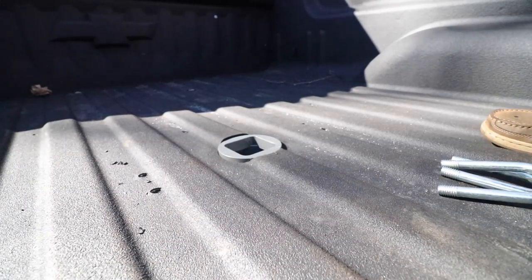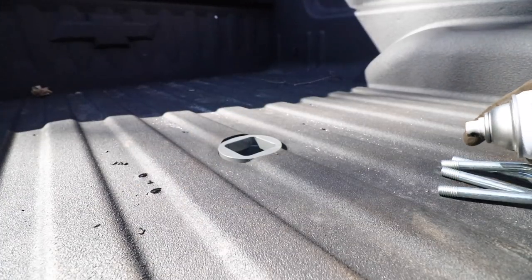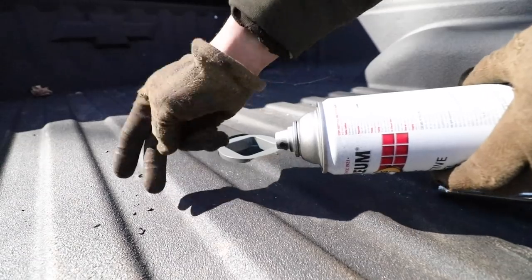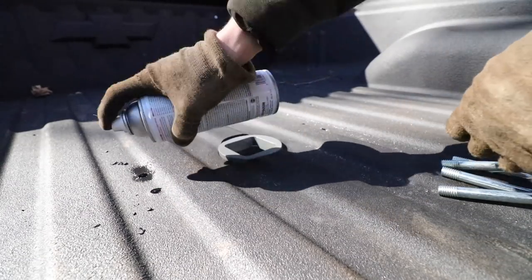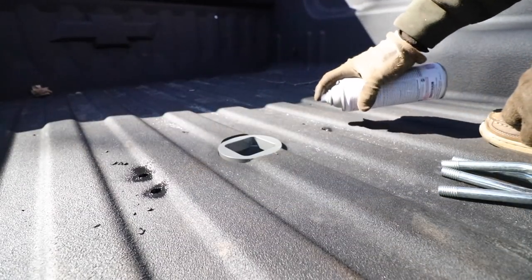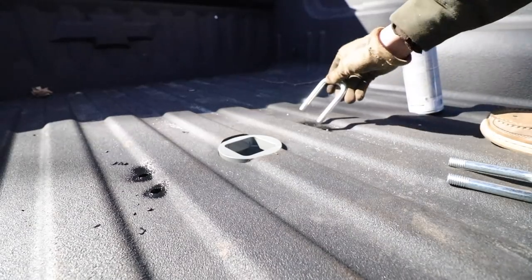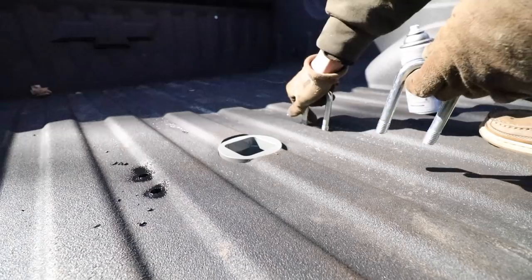Well, I'm very pleased to say everything's looking excellent so far. Now, this step is optional. I did it earlier when I installed the main ball hole here, but because we just bored fresh holes into our bed, there's going to be some bare metal, so it's up to you. If you want to take some spray paint, just coat that shiny metal, trying to prevent rust from spreading. I don't really care if I got black marks in the bed, but now I can drop my U-bolt safety chains, hooks, and the holes, which I don't know if they're going to fit.